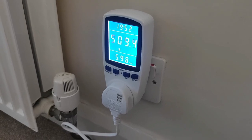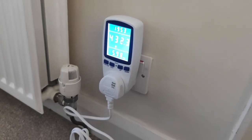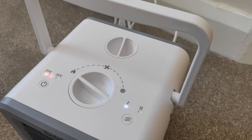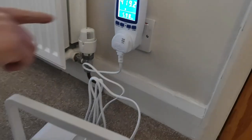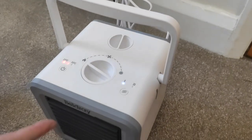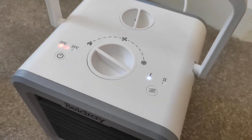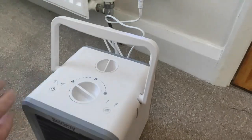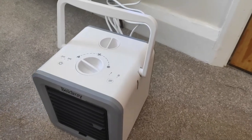You can feel the heat — it's not being driven as hard on setting 1, but I think you may as well just leave it on 2 because the difference is just not that great. If it dropped around 300 watts I'd be happy from an economy standpoint. It looks like it's flattening out around 419 watts, but it'll cycle on and off, so it won't stay like that for the full hour. It's also got an auto cut-off if it overheats or gets blocked — that's it, thanks, more next time!